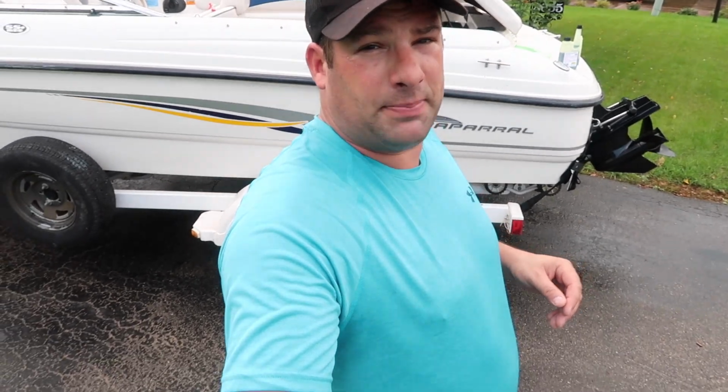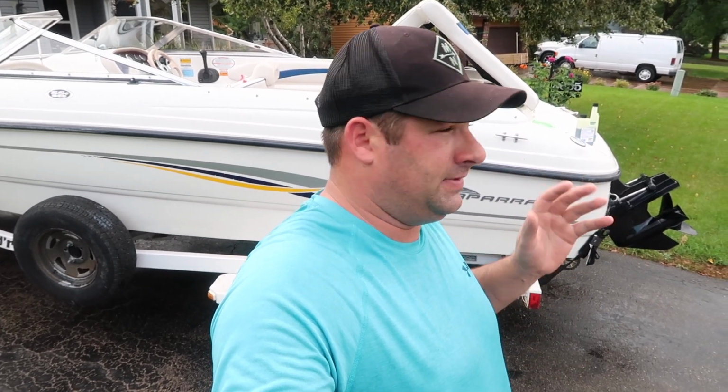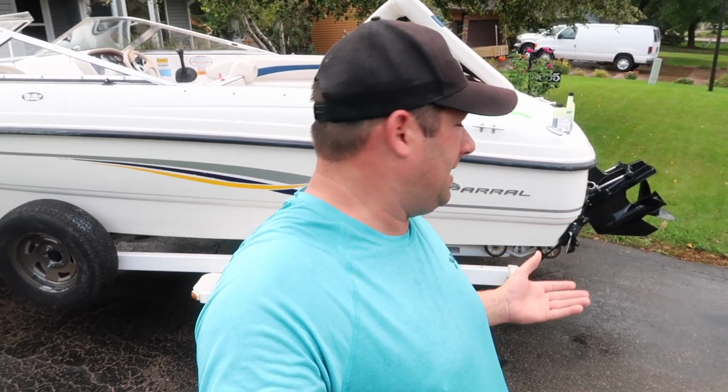Make sure you get a proper cover, maybe a tarp, and build it so snow won't collapse it. And that's how you maintain a boat. You wanna make sure these investments stay nice. And then I'm gonna put the wheels on bricks so it doesn't get frozen into the ground, because I'm gonna store this boat outside. I'm gonna make sure I have 2 tarps over it, and the snow is gonna fall off of it rather than sink the tarp.